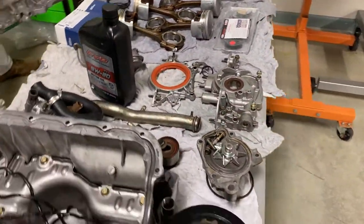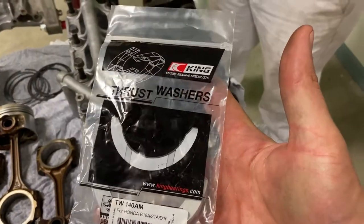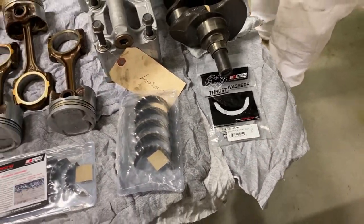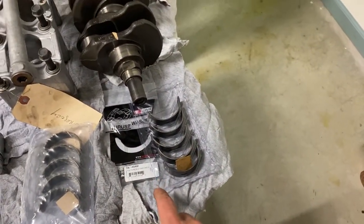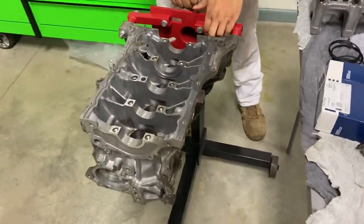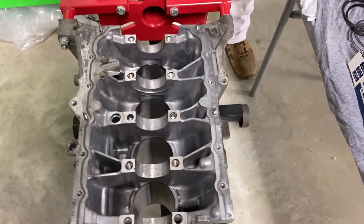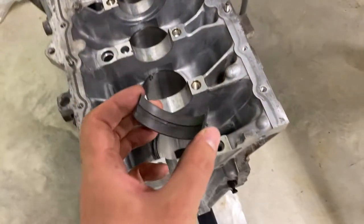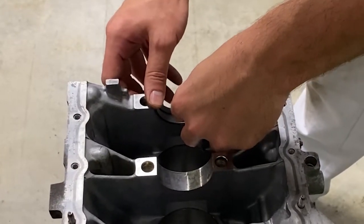What we're going to do is go ahead and put the main bearings in real quick. These are King Racing bearings — actually about a quarter of the cost of Honda bearings and they are meant for racing. These are the extra clearance version for the heavier oil we use, which is 20-50. So what we're going to do is wipe these clean, put a little film of oil in here, and then seat the bearings. The tab goes right in there — push the tab, get it squared up, and just push it in.